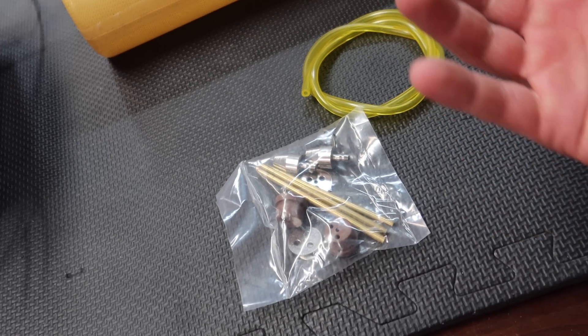There we have one of the tanks installed. You can see the two sets of safety wire I've installed. The reason I use two on a tank setup like this is because there are no barbs or nipples on these tubes. So we've used two rounds of safety wire — one at the top and one at the side — so any pressure points are not in the exact same spot. We're not going to put the vent line on yet since we still have decent access to that area.